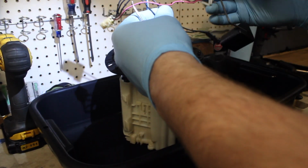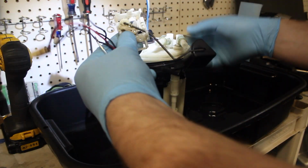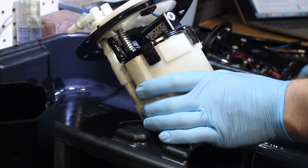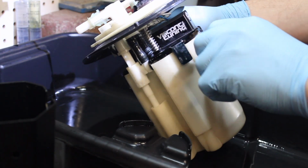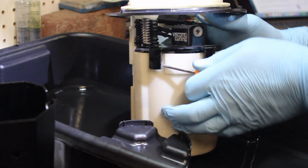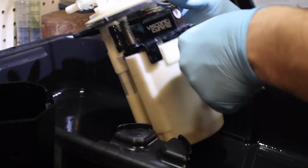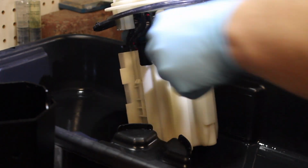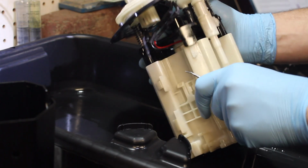This is the fuel temperature and the fuel level. So this is going to go over on our new basket. If you need to take apart your basket, it will be kind of similar if yours is OEM, but there's 4 tabs, and basically you just need to pry and push up, and just continue around until you'll feel it finally loosen up for good, and that's how you get that out.